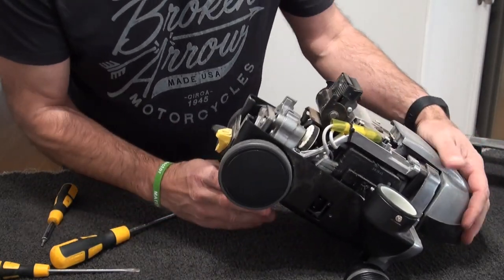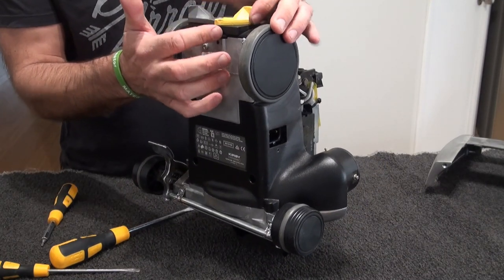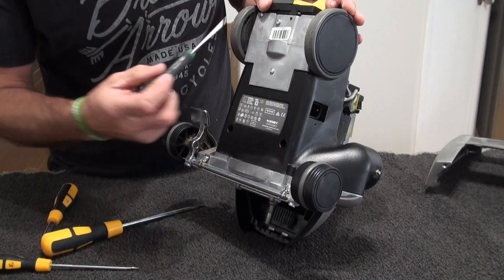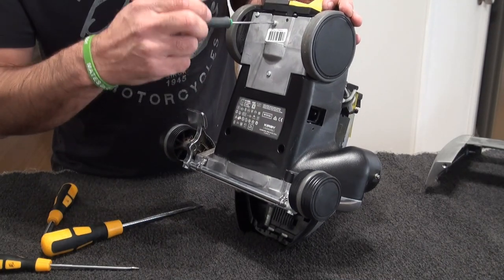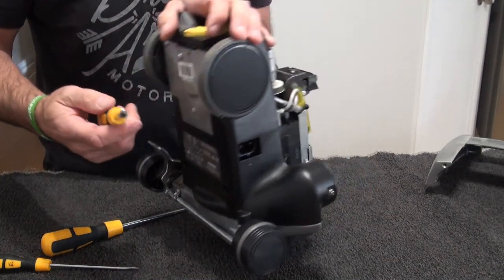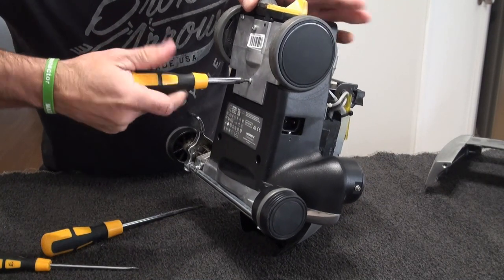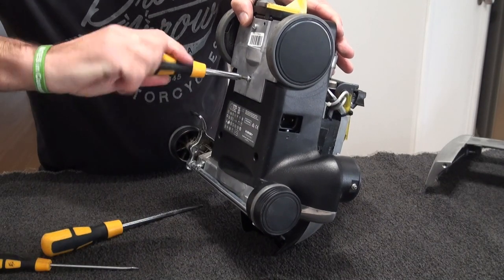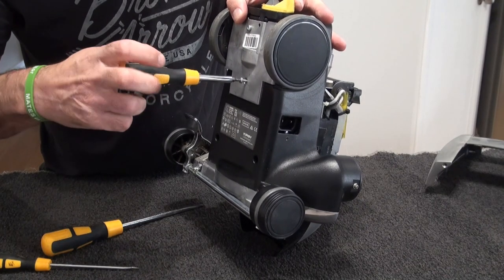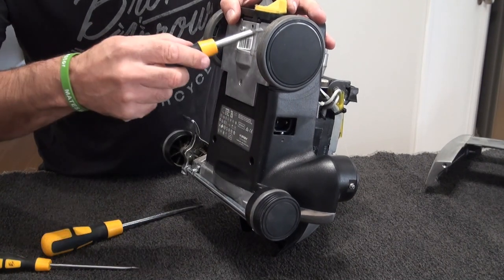Now under your tech drive, it's literally your three screws on the back. This is one that holds the adjustment. So again, you shouldn't have to undo that, not straight away anyway. So what we'll do is get our Torx screwdriver. That one, no, it's the next size up. And it's that one, and that one, and that should come out. And I think that was the screw that was holding the casing at the top. So undo these three, and again, make sure your tech drive is in drive so it comes out. This will literally drop out. Undo that.